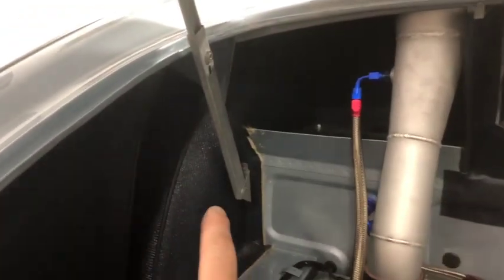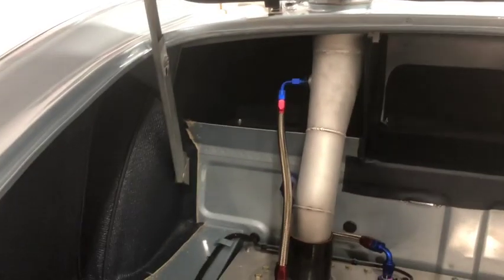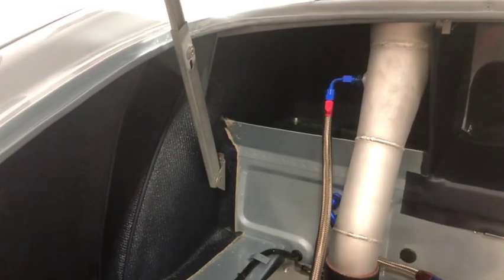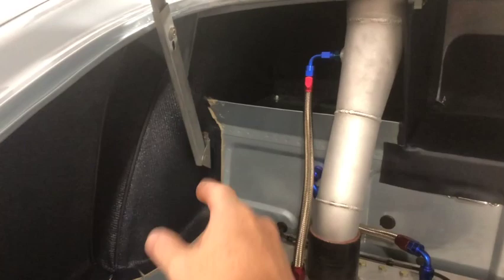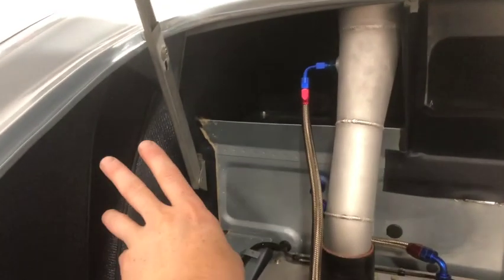On the right-hand side you're going to have to — I always just use like a broom handle or something to temporarily hold the boot lid open. You have to unbolt that, then put in that rear wheel arch cover and locate the holes from the backside through the wheel arch, poke them through, and then reinstall the wood block with its bolts and the prop rod.